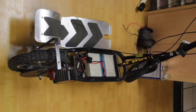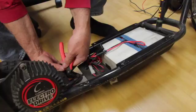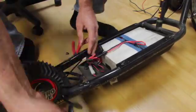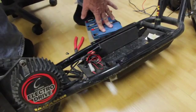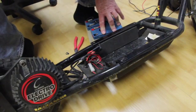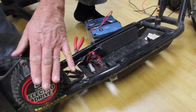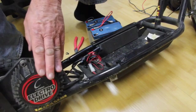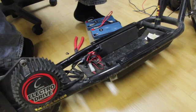So let's get started. Let's go ahead and pull the batteries and pull the motor — we want to do some bench testing on the motor and the controller. What we're going to do is test the battery, see if the batteries are any good, then yank the motor and do a test. This is supposed to be a brushless motor, so I'm going to test the three different phases on the motor and we'll see if the Hall effect sensors are good or not.